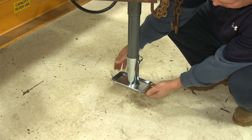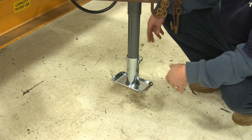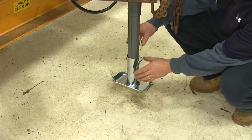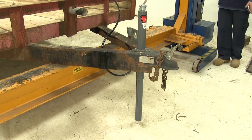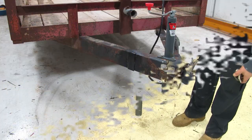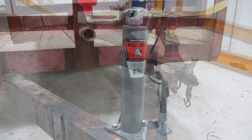By adding this foot, it allows you to unhook your trailer in softer soil or dirt so that the jack itself doesn't sink down into the mud. It also gives you a wider footprint to provide more stability at the tongue of the trailer. In today's video, we had the trailer up on a set of lifts. If you don't have a set of lifts, you can either support the trailer on jack stands, or another easy way is to simply hook it to your tow vehicle — that will allow you to remove the old jack and install the new Bulldog A-Frame trailer jack.